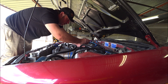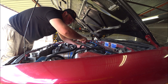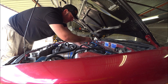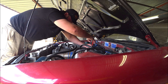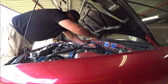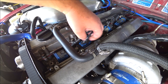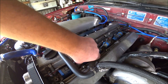I still have to fix that exhaust leak - another thing on the to-do list. I wonder if that could have anything to do with it. I don't think so, but the O2 sensor is after that. I doubt that would cause that problem - it wouldn't be that far out. This is not metering the volume of gases, it's just metering the content of the exhaust gas. Okay, so all the coil packs are free, let's get the loom out of those so we can pull any individual coil out one at a time.